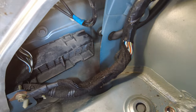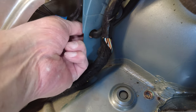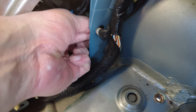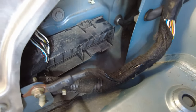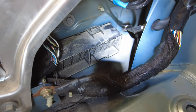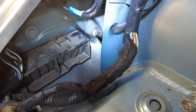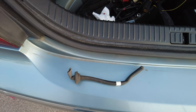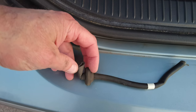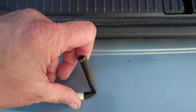It's completely smashed going through that hole. Whoever designed this — I mean, it's a manufacturing detail — they've got this white hose and wrapped tape around it to give it some strength, but it obviously wasn't enough. Here's the grommet right back there that we're dealing with. The right side was red and the left side was white, but this is right up against the fender well — totally kinked.